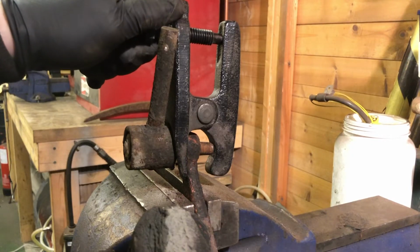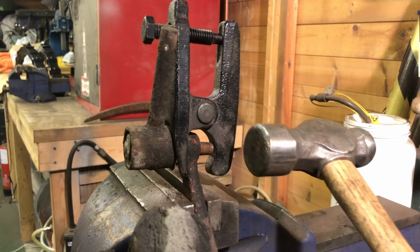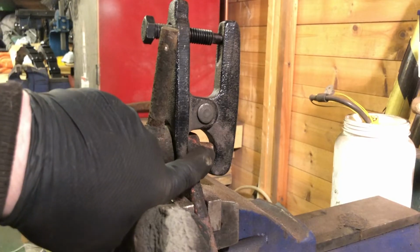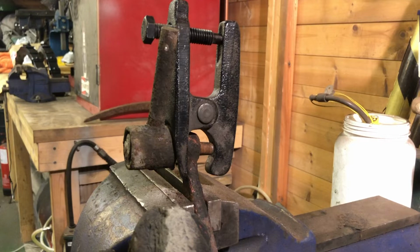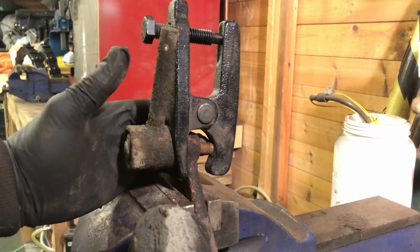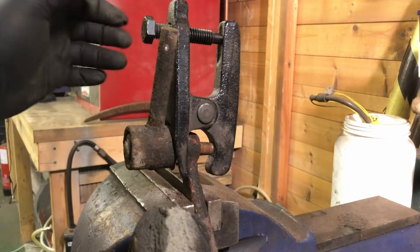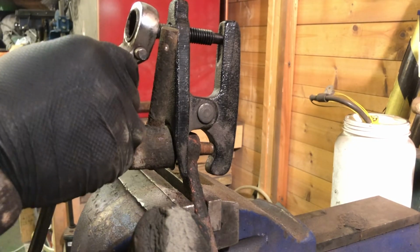Now this is much better. I've seen people separating these by hammering the crap out of that screw there, hitting it this way, and then trying to reuse the thing they've just taken out, like a track rod end, when they've just knackered the thread. Again, there's this option, which I don't really use that much, and there's this one, and that thread's pretty well protected there. If you want to doubly protect it, I suppose you could put a piece of sacrificial aluminium or something in there, but it's absolutely not necessary. Anyway, what I've got now is a ratchet spanner. Pop this on here.